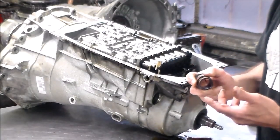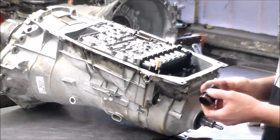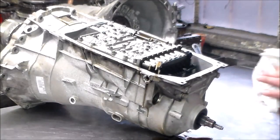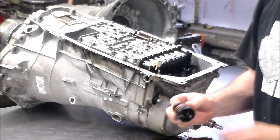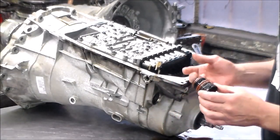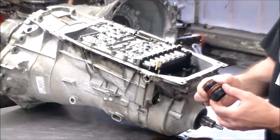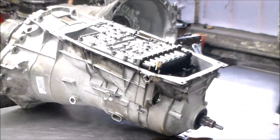He's telling me about the pass-through connector in the BMW transmission. I say, yeah, where the wire's going. He says, yeah, it's leaking. I say, yeah, it's pretty common. He goes, but I changed it about a year and a half ago, and it's leaking again. So I got one from Transtar, and it actually came with black seals on it. And when I dropped the pan and pulled the tab down, the thing just fell right out, and it had these orange seals on it. So you really want to go with the black seals.